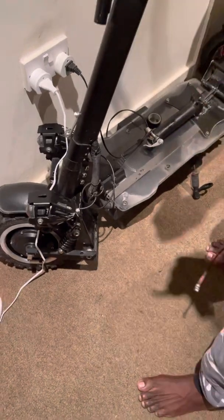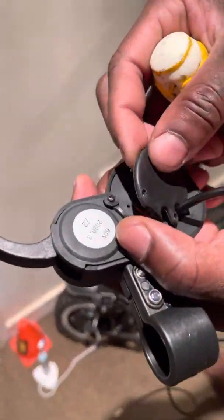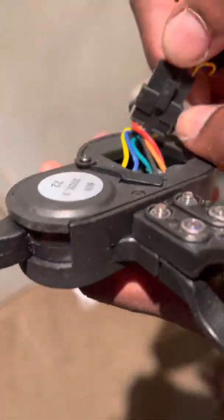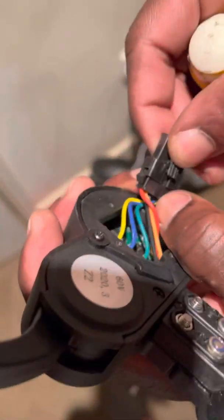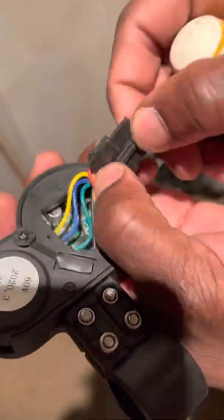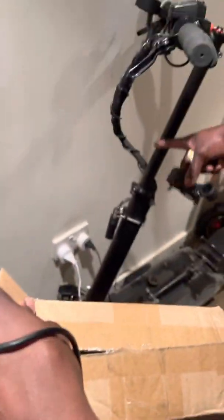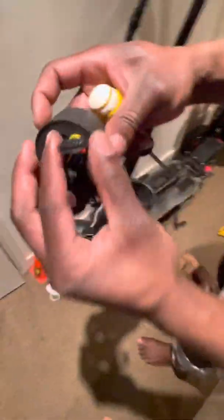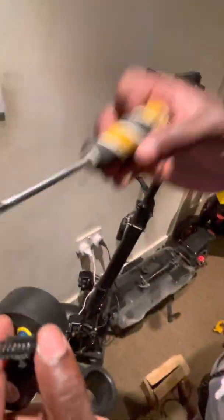Pull the unit to this side of the scooter and make sure it doesn't go anywhere. When you open it, you'll see the plastic cover. In this situation, all you have to do is press on this connector up here and you can pull this out. Once that's out, this is what you need — you don't need the whole wiring system, because you now know there's power coming from your controller into the accelerator.